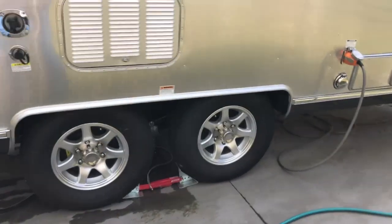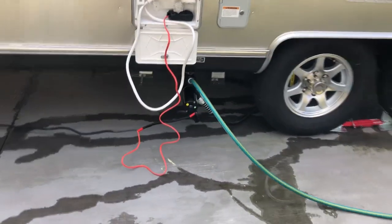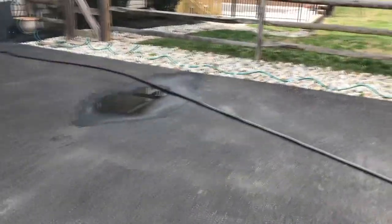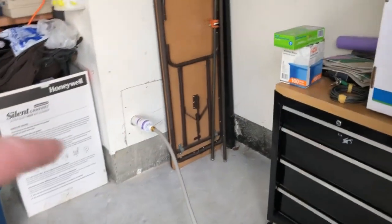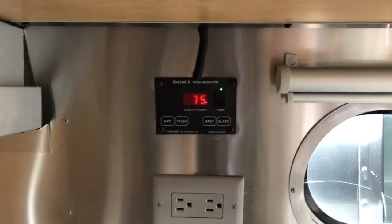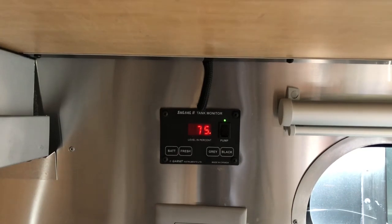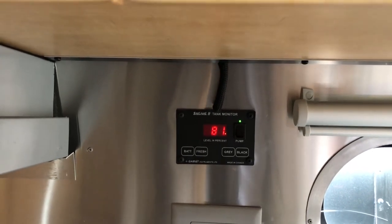I have drained the water out — it's at zero, though there's probably a gallon or two left. My tanks are getting full, so I've hooked up my pump to the external power I've shown in other videos, pumping into the main drain into the house. Now that I've drained my waste tanks, I am refilling the freshwater tank. I'm at 75 now and I'm going to fill it back up and flush everything through the drains using the faucet and pump rather than the low-point valve.